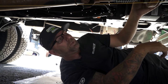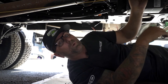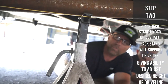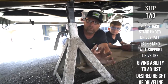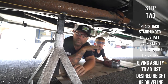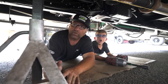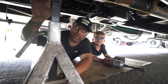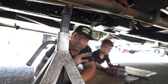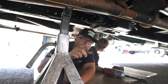Now what we're going to do is remove these bolts, and you can see from the factory that they've already put four spacers in there in order to space that down. You can also see that there's a two-inch spacer up on the front to space that one down. We're going to bring this down even farther — we're going to try a two-inch spacer in there and see how that lines up with our string. What I'm going to do now is take a jack stand and put it underneath my driveshaft. I want to be able to support the driveshaft because I don't want this whole assembly to fall all the way down to the ground.